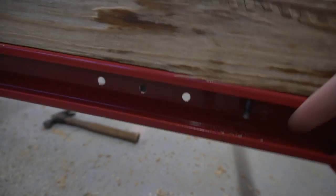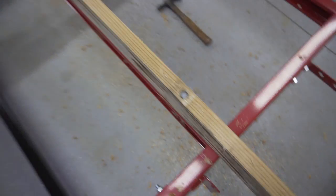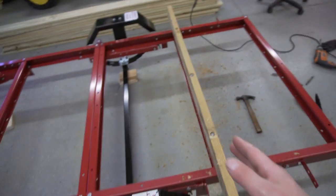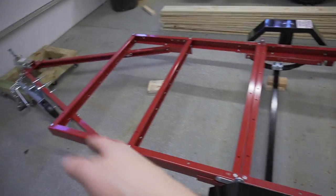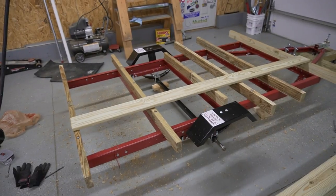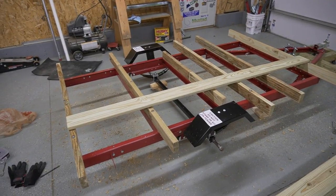It's a pain, so I'm probably never going to fold it. I might as well put pressure treated on the top and let it sit outside — the wood will probably last longer than the trailer will. I bolted this all the way down through some nylock nuts, made it five and a half feet wide, turned it on edge and bolted it. I'm going to do that on every cross piece and then we'll plank it. We've taken a four-foot wide trailer and turned it into a five and a half foot wide trailer.